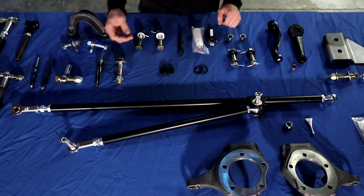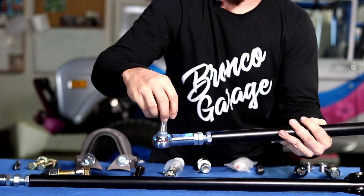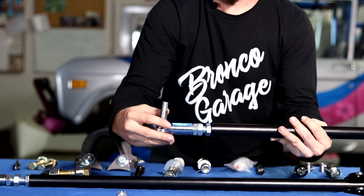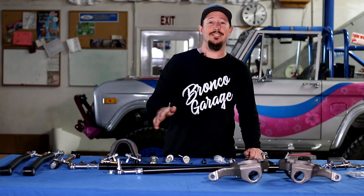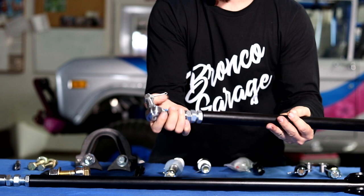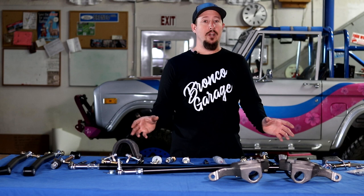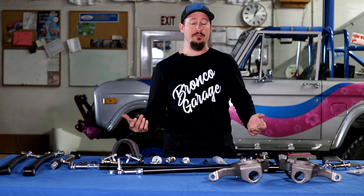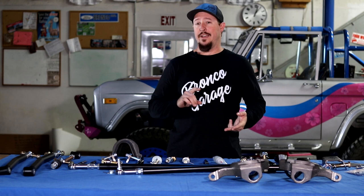Another great feature is at the attachment point of the pitman arm: a tapered heim stud that's actually pressed into the heim joint. There's also a bushing on there so you can use this from 66 all the way up to 77 without changing out your pitman arm — which is great because pitman arms are actually really difficult to drill to a three-quarter bolt. Overall, one of the really great features of this new dual sport heim steer system is that it is universal between the years of 66 to 77 early Broncos, covering all the different oddities that came in those years. As long as you have a factory style gearbox, a factory style frame, and a factory style front axle, this system will bolt right in.